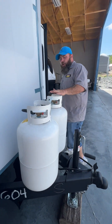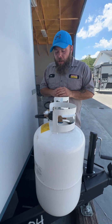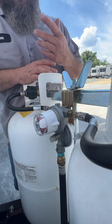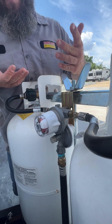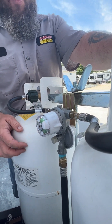Next, back behind that is going to be where our two 30-pound tanks are located. These guys have both been filled, minus what was used to check the propane system. This here is going to be your regulator. This tells you what tank you're using by this little notch on here, but it also tells you when the canister is empty. It's reading red right now because it does not sense any propane flow. I'm going to go turn this on — that's going to flip to green, showing us that we have propane flow.